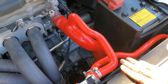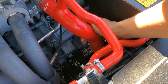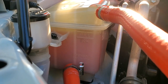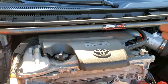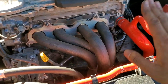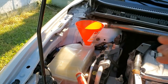As we're waiting for all the coolant to go into the system, go ahead and squeeze this upper radiator hose — that will help get any air bubbles out. It took about a gallon and a half of coolant, but it's finally stopped dropping in levels, meaning it's about time to burp the system. We're going to leave the radiator cap off, start up the engine, let it idle, and make sure the heat's turned on in the car. We want to get the fans to kick on, and when they kick on that means the thermostat's opened and that'll let the trapped air out. You'll notice the level drop down, and when that happens we'll just add some more fluid.